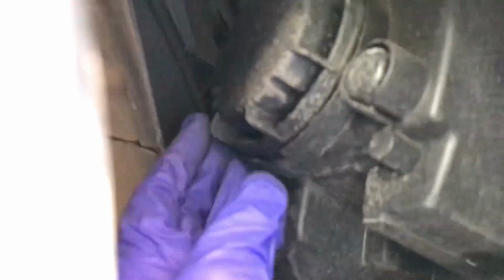And then you're able to bring that hand in and where you want to be, which is where this dust cap is. If you see my hand, hopefully you do. I can't really tell, but there is the dust cap for the headlight that I'm going to be replacing. I'm going to try and do lefty-loosey to remove the dust cap, and we'll see how that works. Now, I cut up my hand a little bit on this part when you're reaching in, so hopefully you have little small hands, or you can come up like a weird angle, but you want to be able to get inside there to this dust cover cap to gain access to your headlight.